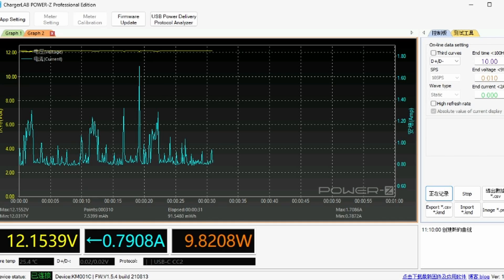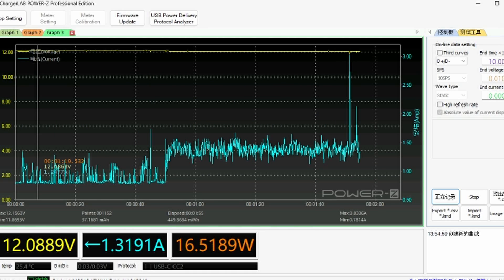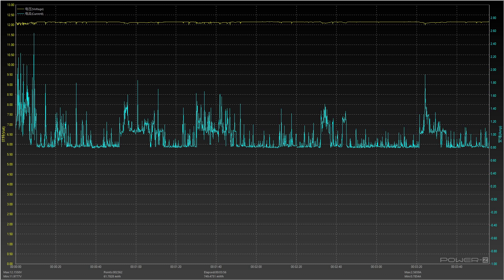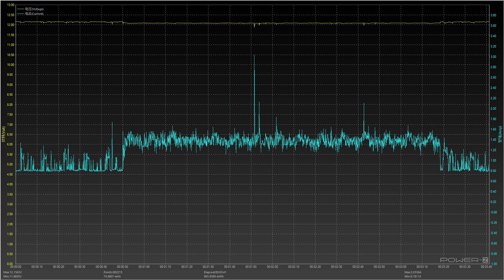With this configuration, as far as power usage, it only takes about 10 watts idle — I see around 9.5 to 10 watts — and when doing transcodes and putting it under stress, it jumps up to around 17 to 18 watts, which is amazing, and that's running two hard drives as well. Here I have a graph of the boot process where it idles, starts up all the containers, then idles back down. The peak you'd ever see is probably 18 or 19 watts on first boot, then it stays around 10 to 15 watts. Under stress testing with transcodes, you can see it jumps up to around 18 watts.